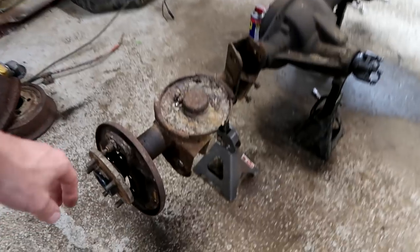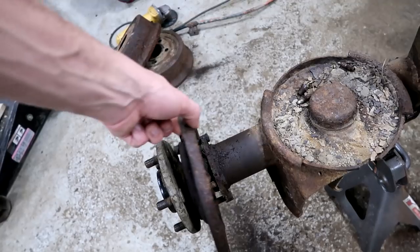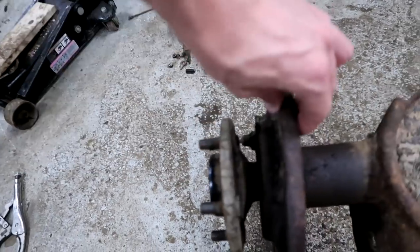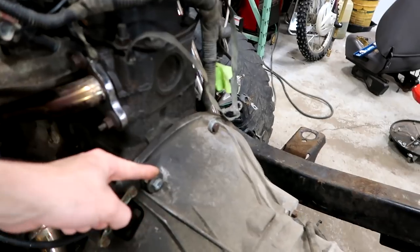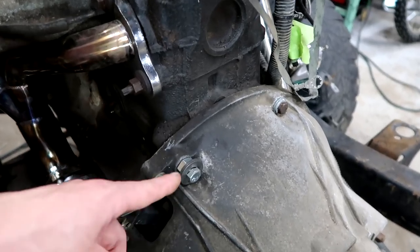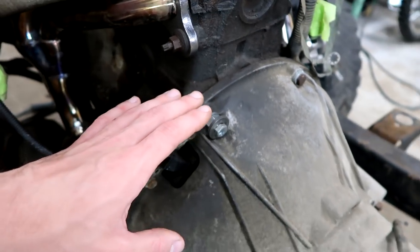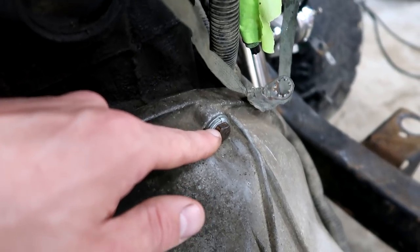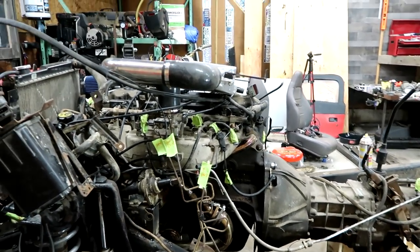The diff is done and ready to be sandblasted. I'm keeping this dust shield just like this so when he goes to sandblast he can get here and here, and if he needs to move it he can. Now this transmission was missing a few bolts, so I put some in just for joining purposes — one with two huge washers and a nut, definitely not factory, and another with a lock washer and regular washer which is slightly more suitable.